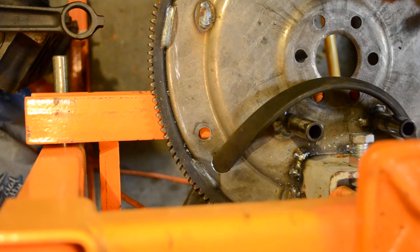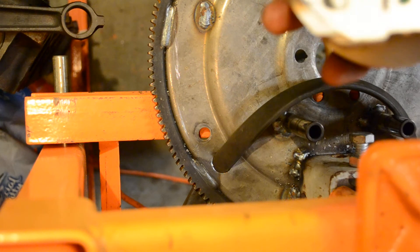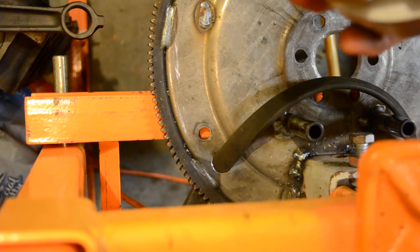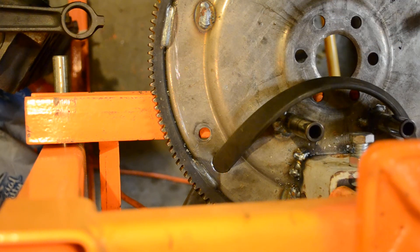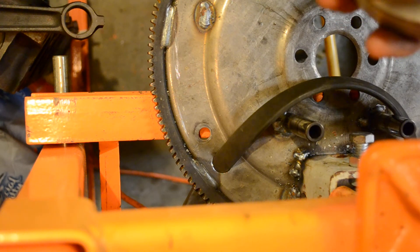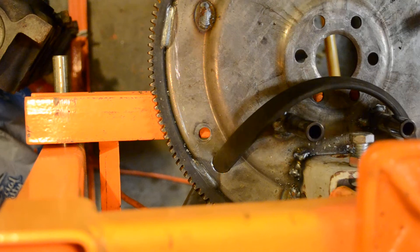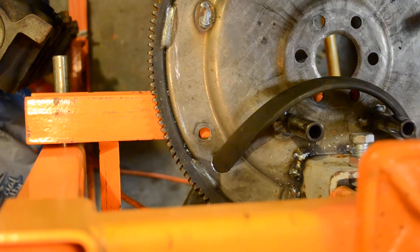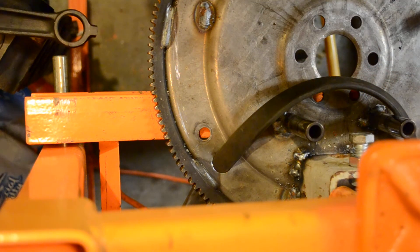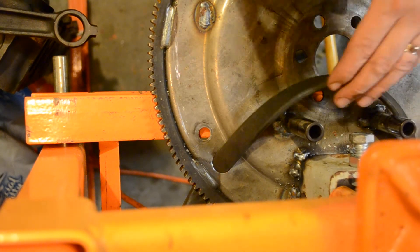Got my piston here. This is the old number three. What I did was I took the pins and I put them through, made sure each one had the same amount of tightness. I don't know if that makes a big difference, but I felt like I was doing the right thing. I numbered the pins and pistons, and I'm also making sure I got the right rod — that's the number three connecting rod.